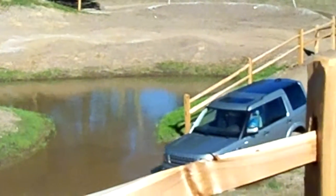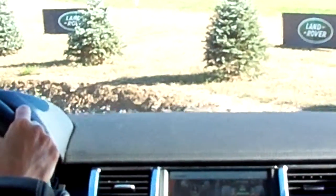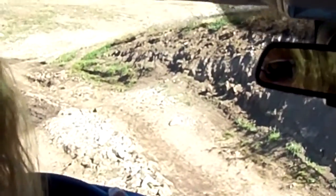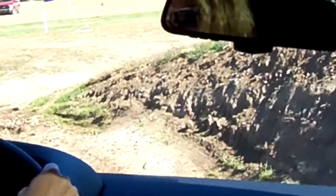It saves the brakes, same as if you were towing. Okay. You ready? So I shouldn't have to use the brakes, no gas? Nope, you shouldn't have to use the brakes because hill descent is on. So just all the way off the brakes. That's hill descent. Cool. So we try to use the gears in conjunction with hill descent, rather than just relying on the hill descent. If we were in second, you would have heard the hill descent work even more so. So you can just give it a little bit of gas. It only controls the brakes, it doesn't control the gas.